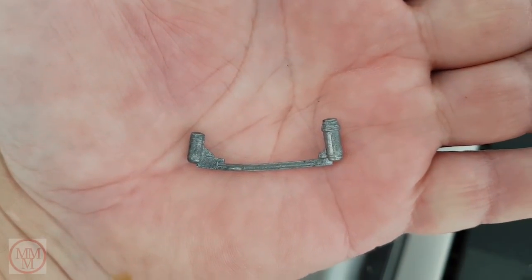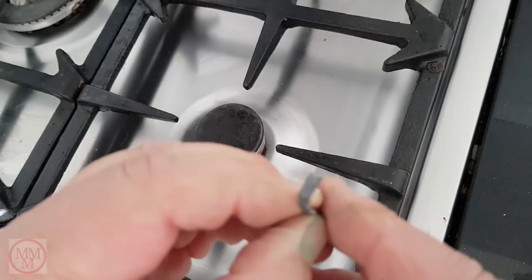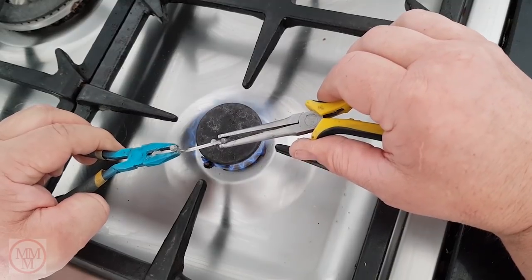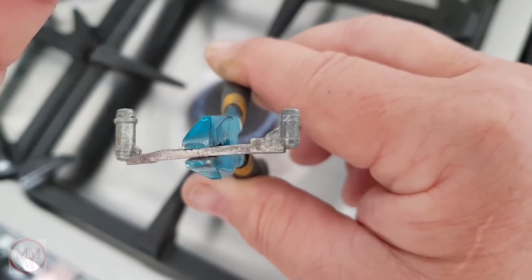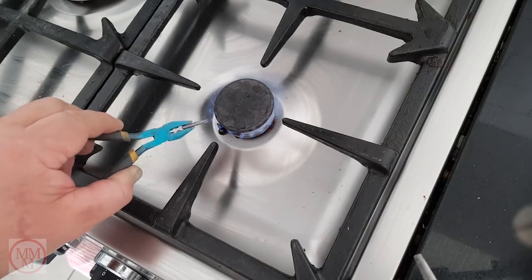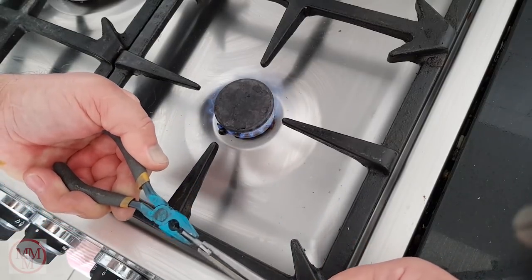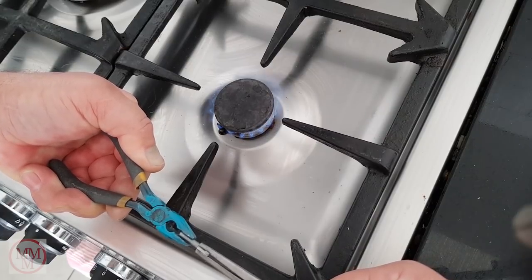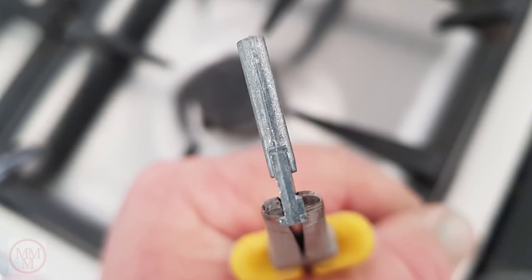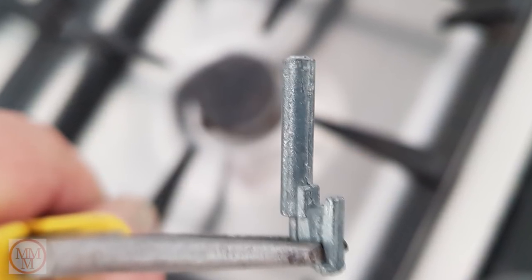Now here's those air cleaners. You can see they're twisted and bent. Now, I'm gonna risk ruining everything here. I'm just gonna put this very light metal item over the gas on my stove and try straightening it. I'm really scared I'm going to wreck everything right here, but here's the exhaust stack, and that tab on the bottom was twisted. I just heat it up for half a minute and it comes out really good. No damage there. I figure if I did it when it was cold, it might break or snap. So that's why I heated it up and it seemed to work quite well.